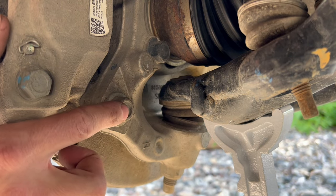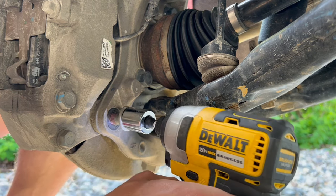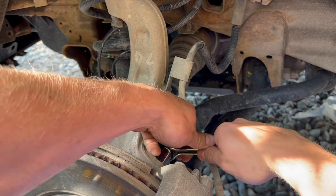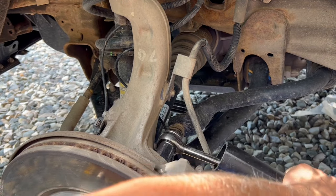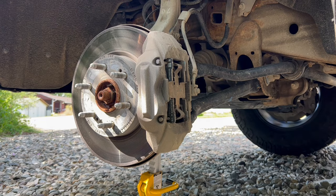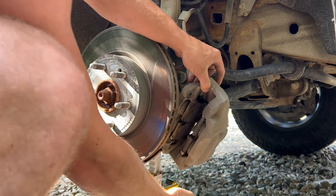In order to get this caliper off, this bottom bolt is what you're going to want to take off — that is a three-quarter inch bolt. The next bolt you're going to be taking off is right here to take the rest of the caliper off. This bolt is extremely tight, so I just have a little extender that's going to give me that extra leverage to turn it off. Once I have that started, I can go ahead and grab my impact and get the rest of it off that way. Once I have those bolts off, this caliper slides right off and you just let it hang there for the time being.